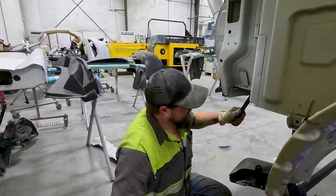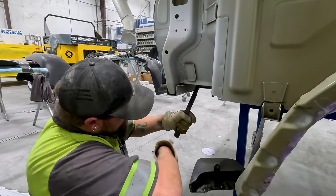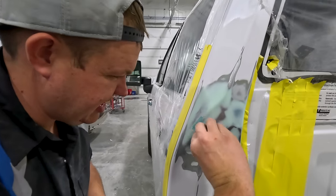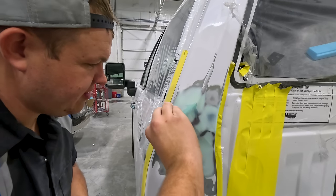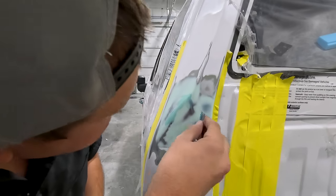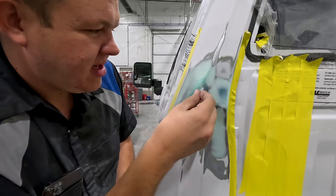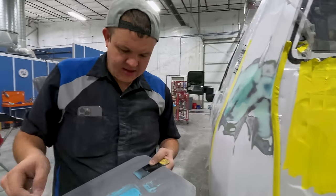So I got all the spot welds ground. I'm just going through them with the seam buster and busting them. But it should be falling off here shortly. But just like I said, we're just gonna razor blade the glaze into the pinholes. So the razor blade helps you control it to where you're not overspreading, and it's just pushing it right down into the pinholes. There's a couple small ones that primer will get. There's people that say that they get pinholes, and there's people that lie about it. Which one are you? Okay, I'm gonna call that good. We'll go get this cleaned up.